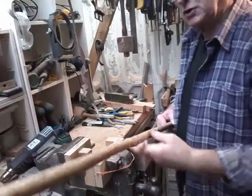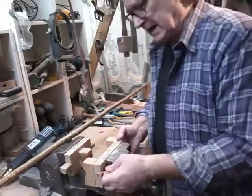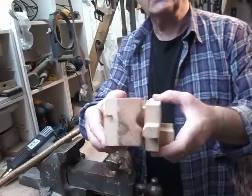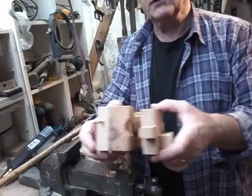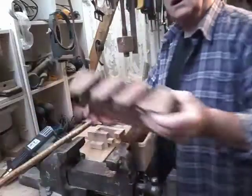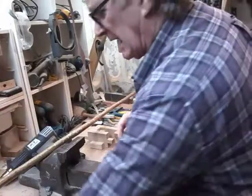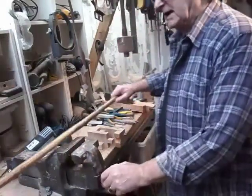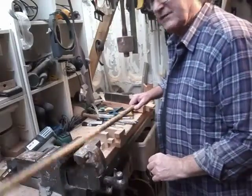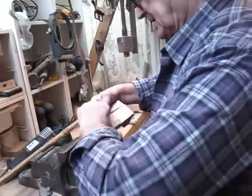So what I'll do is settle these two big bends here first. Just to give you an idea of the very simple things I use: I have a couple of blocks — that one just puts pressure on the high spot and bends it in. We've also got a very old-fashioned notch system which you can swing on. And in the end it's quite easy to just pop your shank in the protective jaws of the vice and give it a tweak.